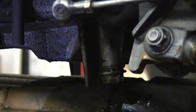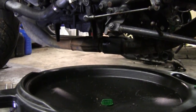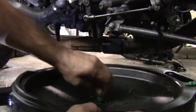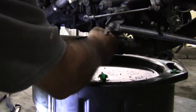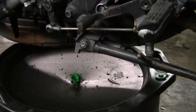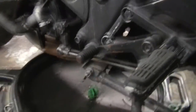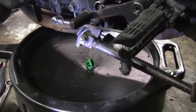He had a piece of plastic jammed in the oil fill cap when I got there, and it looked pretty new — it didn't look weathered like the rest of the bike. So he might have just put that in there. That means water was accumulating into the clutch section, and the plug itself on number four — there was no plug in, the boot was half in. So we got water coming down into the bike in one or two places, probably both. The fact that the motor turns over — whatever. You bought the bike cheap, so you can put some time into this.